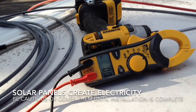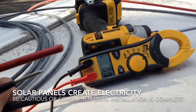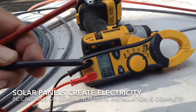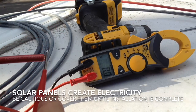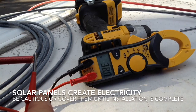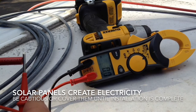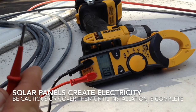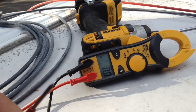I've got my voltmeter out here, and just the raw ends of the positive and negative leads — they are now connected to the panels. I only have one of the panels connected at the moment because I'm missing a couple of MC4 connectors, but I can still show you. When I attach my multimeter leads to this wire, you can see we're getting 38.4 — it's fluctuating — 38.6, 38.2. We are somewhat overcast right now too, so this is primarily stored energy.